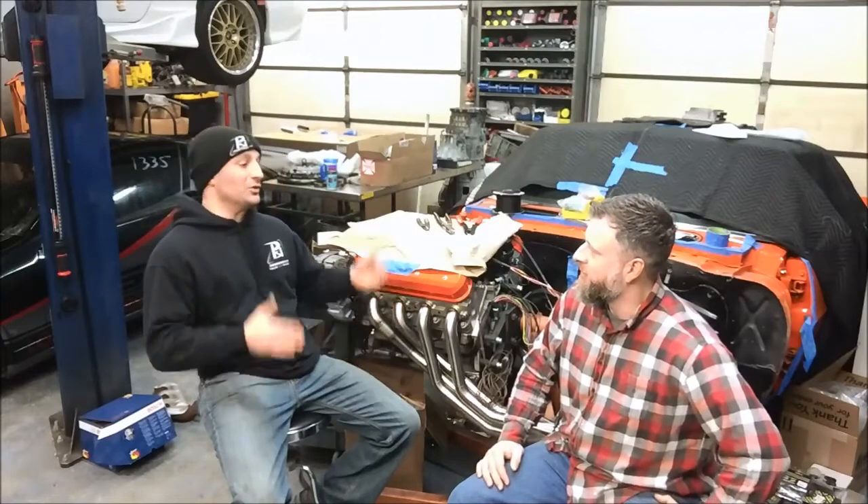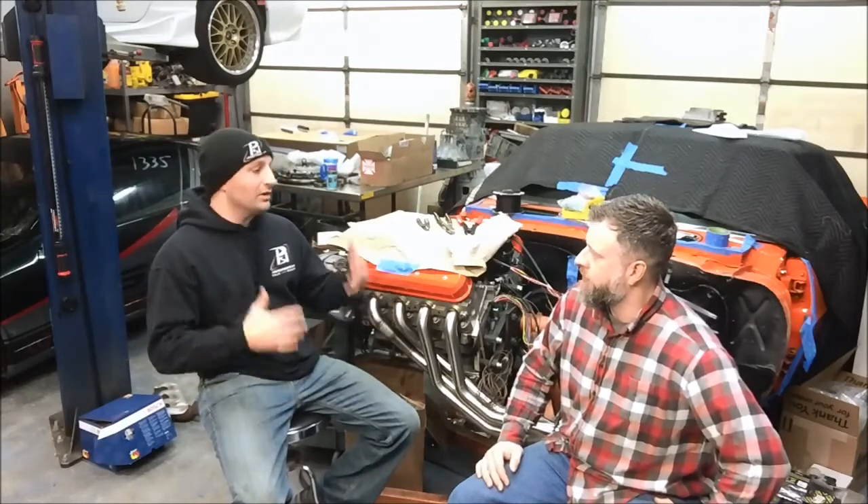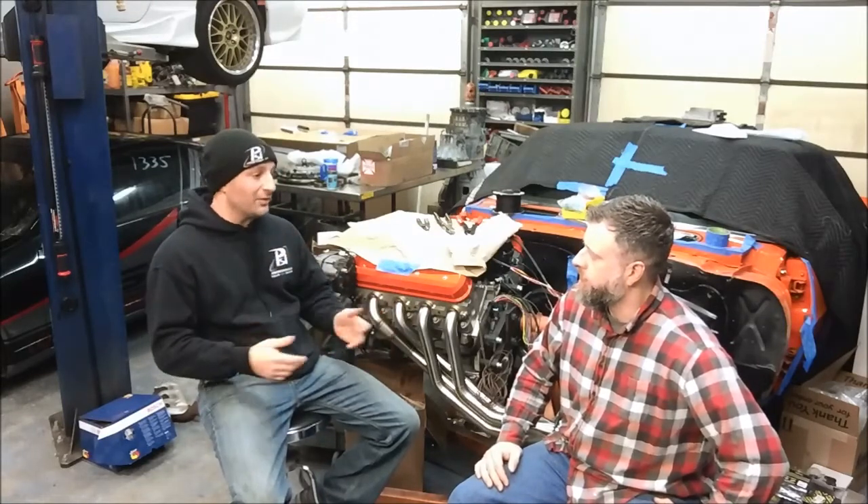That's key to understand, because customers — everybody's trying to save a dollar and reuse certain things. Let's say they're going from a drive-by wire green and blue 2005 truck engine, and they're throwing an LS6 intake on it with drive-by cable, and we sell them a red and blue computer with harness. They'll sometimes try to cut the ends off our harness and use their old O2 sensors, and all of a sudden their O2 sensors don't work. The reason is you're using a non-case-grounded O2 with a case-grounded system or vice versa. Whatever our part numbers say inside our manual, that's what you should use and replace. It's just like replacing spark plugs on a used engine — you should replace your O2 sensors because they do go bad, and it's going to save you tons of headaches later on when diagnosing a drivability issue.